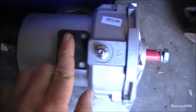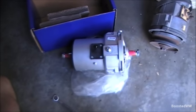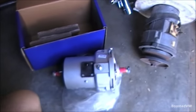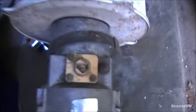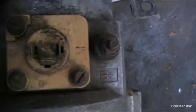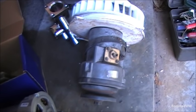There just goes to your battery, and that's the warning light terminal - nice and simple. And that's what Beetles had from about '70, late '75 onwards. But the earlier alternators had external regulators, so if you've got a three-pin one like that with the separate battery post, it means there's a regulator under the seat.